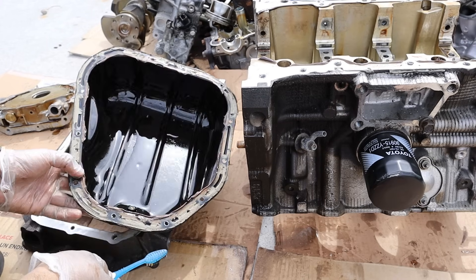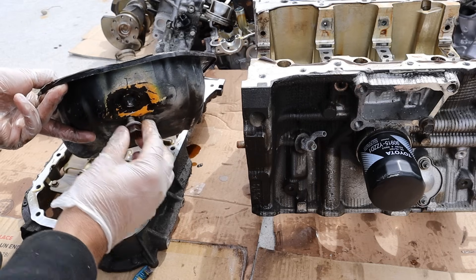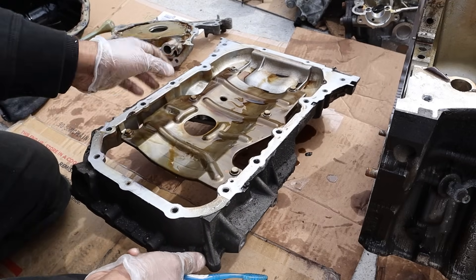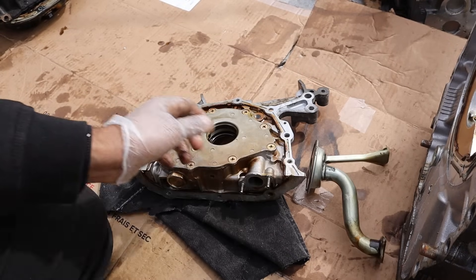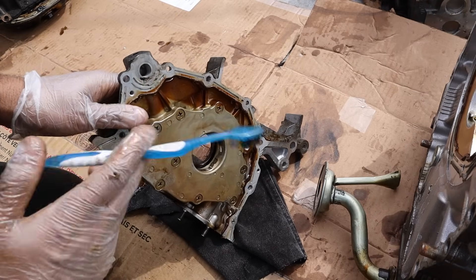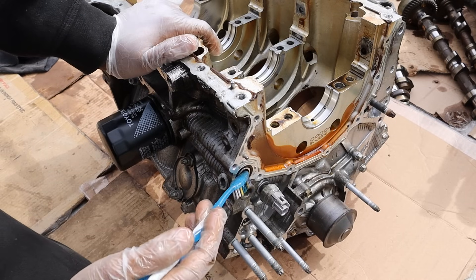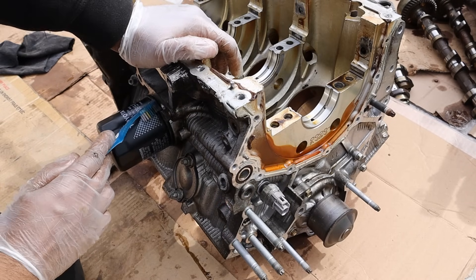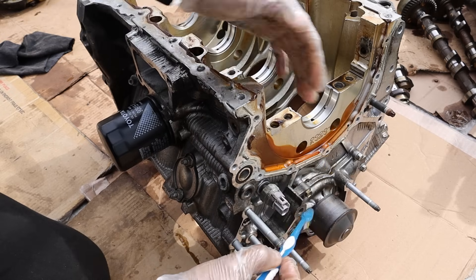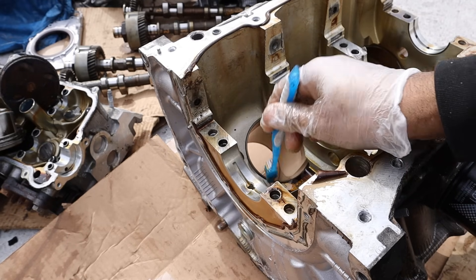With the entire engine taken apart, let's have a closer look at how it works. Starting at the bottom: one thing I like is that they've included a crush washer and an original Toyota filter, so we know this car was dealer-serviced with OE parts. The upper oil pan is just a cast piece of aluminum alloy. The oil pickup tube is looking nice and clean — it feeds the oil pump, which is driven directly off the crankshaft. The pump creates oil flow and sends it up to a port that corresponds to a port on the block. On the back side, you can see the holes drilled to make the oil gallery running down between the cylinders, and also holes drilled from the main bearings to get oil from the main gallery to lubricate the crankshaft.